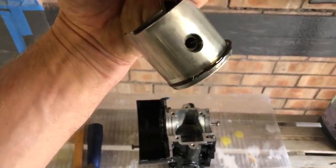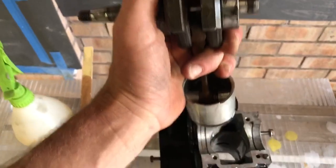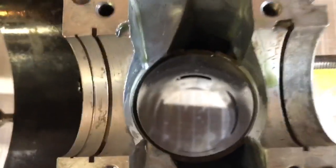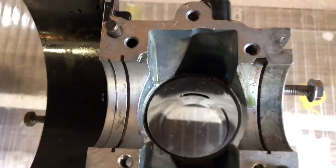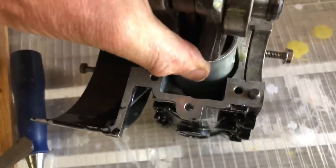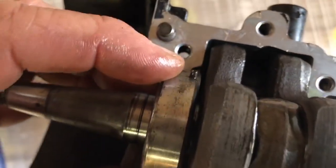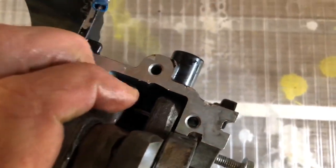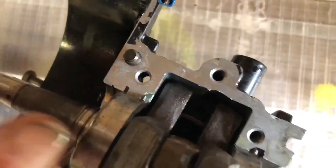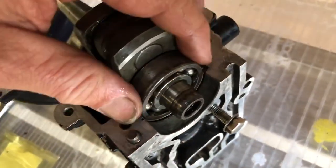I've just put two-stroke oil around that ring, inside the bore, and on all my bearings. This one just pushes in from the back and there's a little chamfer on the bore which helps the ring just sort of pop in. Just wiggle it and it should pop in — there we go, too easy. These bearings have a pin which sits in these grooves. You need to make sure they're not underneath somewhere, because you're going to really wreck your motor.